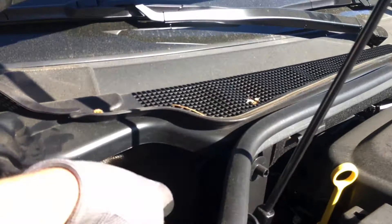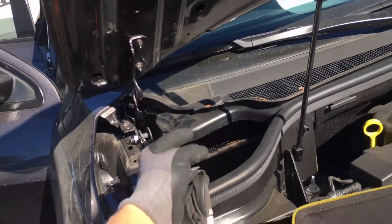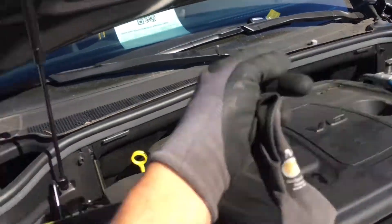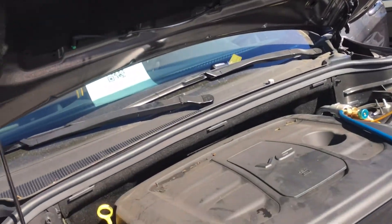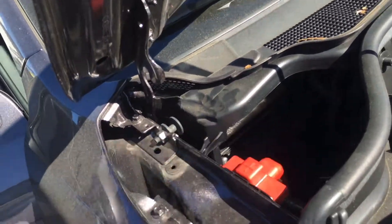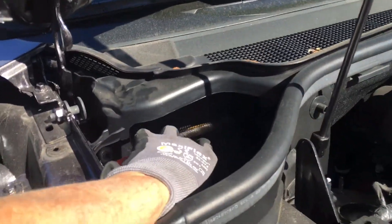The combined air being sucked in here goes all the way across the cowl, gets mixed up, averages out, enters the filter, and goes down. If you place your temperature sensor at the edge, or over near an exhaust manifold where air is getting sucked up at 140 degrees, or down here at 110 degrees, or right here sucking in cool air at maybe only 80 degrees — you will never get the combined mixed air temperature going down.